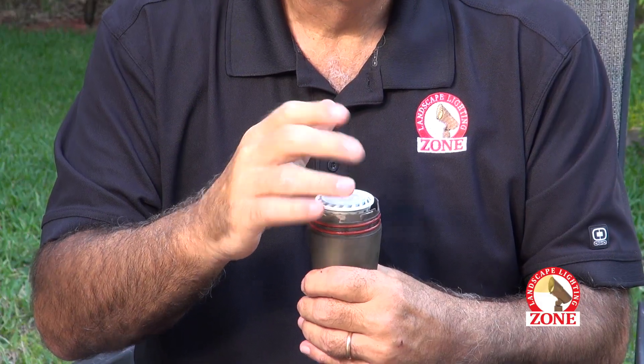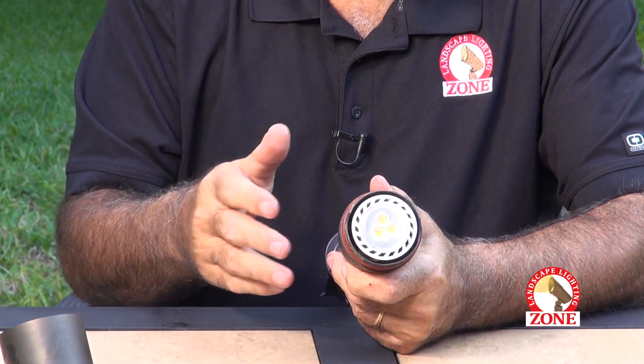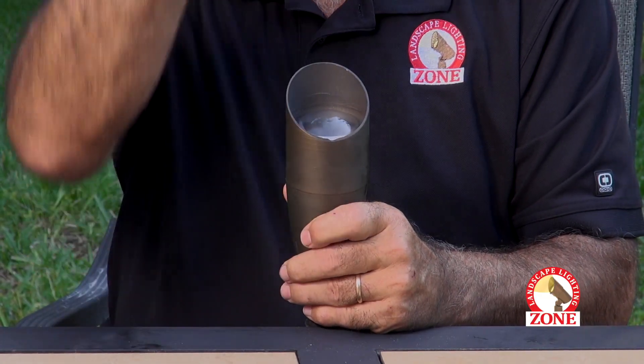If the lamp is not on, then you know you have a different issue. But like I said, nine times out of ten it's just a dislodged lamp — very durable system installed the proper way. Then you just reassemble it. You don't even have to readjust the lamp most of the time because it's still in the same position, or you straighten it out and check that it's still set in the proper direction. That'll take care of 90% of your lamps-out problems.